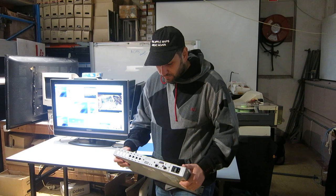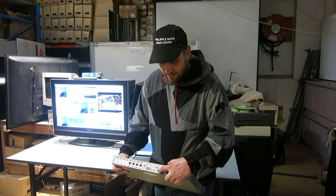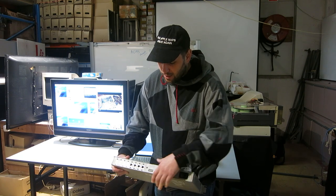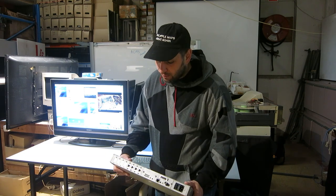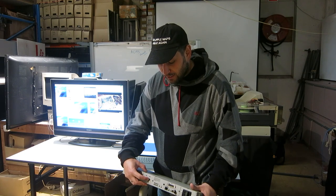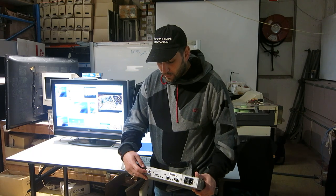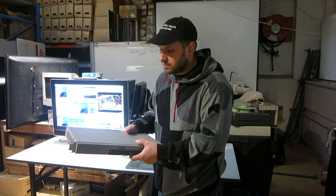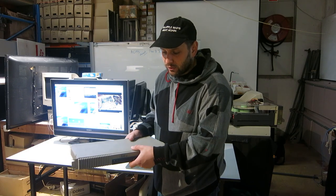Basically it's a little ISP in a box. All you do is put your Ethernet — either thin, thick, or 10BaseT — onto your local network or onto an internet connection on the back, then connect up telephone lines. People from outside the company could dial in. These were V90, V92, or even V34 modems, and it has a little remote access server that keeps usernames, passwords, does your DHCP, and connects people dialing in to your local network.